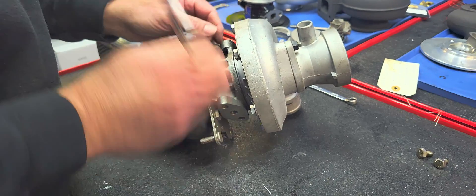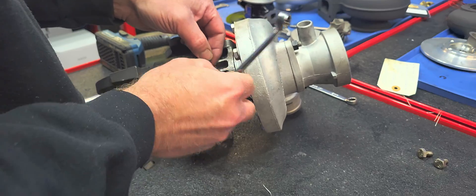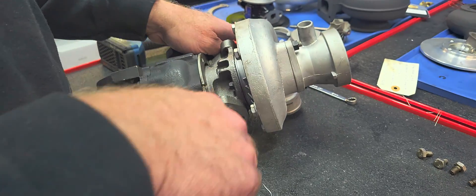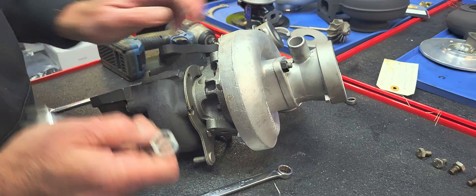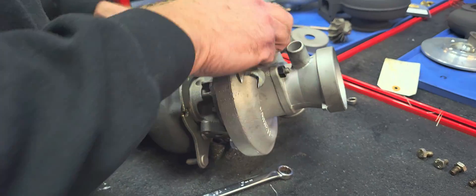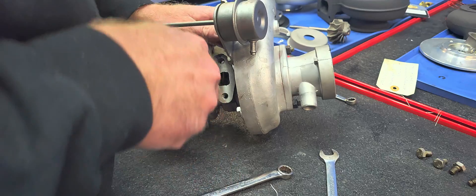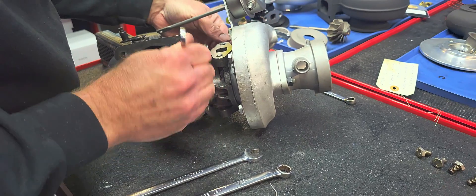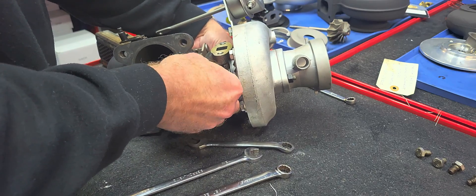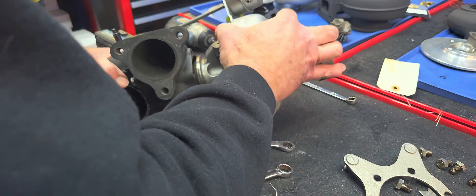There is all kinds of room for error in the Buick, and unfortunately in today's world we also have a lot of engine rebuilders and practices that aren't necessarily acceptable for the Buick. A lot of shops are very professional about rebuilding stuff and capable of handling things, but if you don't know the quirks of the Buick in and out, you can get yourself into trouble. The turbo will always tell, because the Buick doesn't do a great job of filtering the engine oil before the turbocharger, so if there's going to be an issue, we'll see it pretty quick.